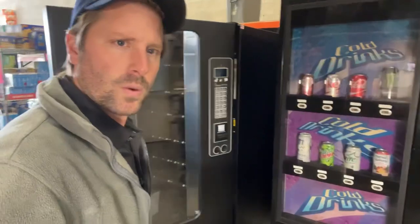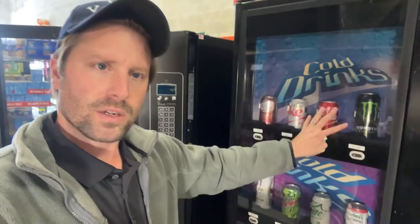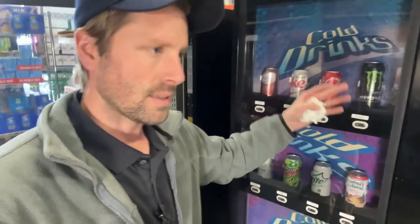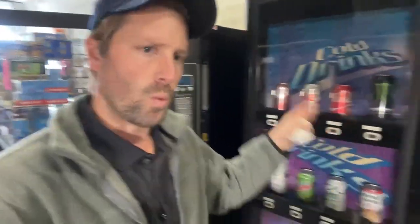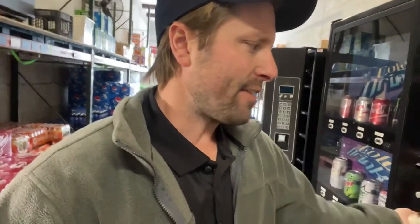Now this Vendo 621 — live display, because you can see the cans in the window. We're going to set it up a little differently: pull the cans out, make sure the depth is set correctly — four deep cans. We'll put water in one of the columns and the account asks for your top sellers, then we can put something else in there. The other thing we're going to do is a refrigeration test — plug it in, let it run for a few hours and make sure it's getting down to temperature. The last thing you want is to install your machine and have warm sodas.